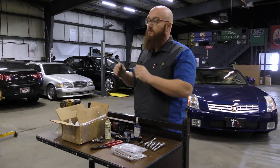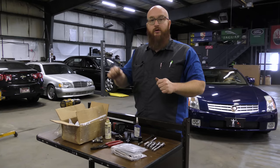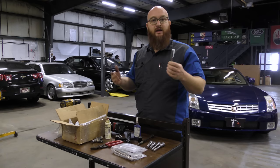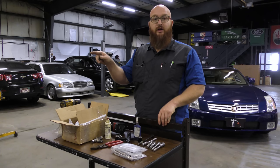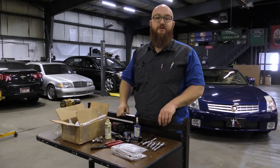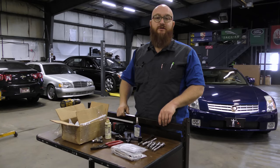When we go to install the heads onto the engine in the next video, we will no longer be doing degrees and backing off and all the torque-to-yield stuff. When you put the head studs in, it's just like a 1950s engine — you set it to a certain torque, the torque wrench clicks, and you're done. No degrees, nothing. I have half of them done so you can see what it looks like, and I'm going to do a few on the other side to show you the process.